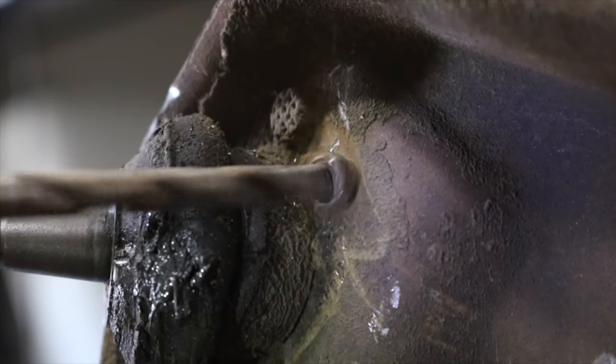The option that I did ultimately go with is these brake lines, part number BH36847. They are for a 1983 Chevy Malibu wagon. The benefit is they have the 10 millimeter banjo fitting on one end and the 3/16 on the other. They're a perfect adapter line to go from the hard line on the 1972 Chevy Vega and the Chevy 2001 Extreme Blazer brake caliper, which is a 10 mil bolt banjo. Whew, that was hard to say.